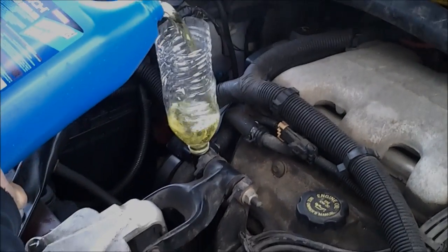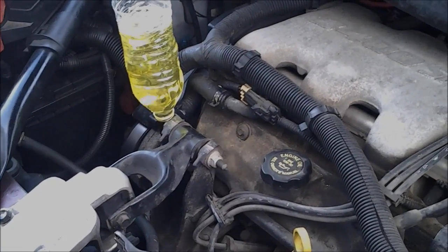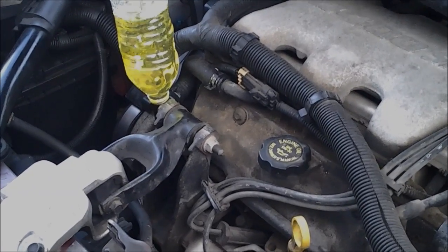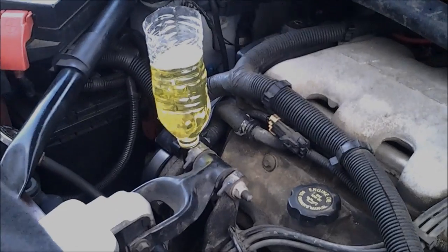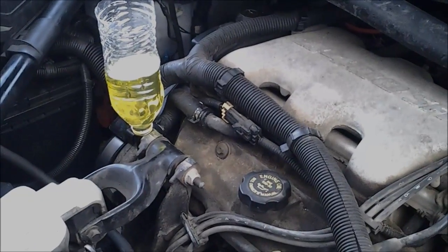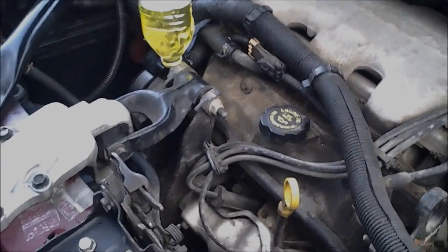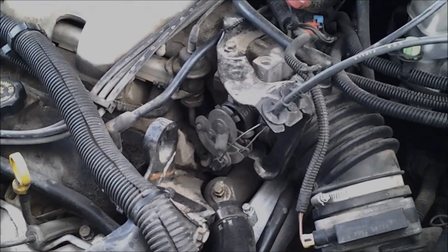We'll add some more — this might take a bit. We've run it a little bit; it just barely started showing the hot, and you can see those bubbles just coming up. The last time I had to do this it took about a gallon. So we just keep massaging this until we don't get more bubbles. Then I'm going to loosen this bleed valve — we're not bleeding any liquids yet, so we'll keep going. Once you get this fluid in enough, it's going to leak out this little bleed valve — that's when you close that up permanently.